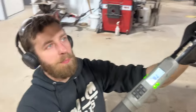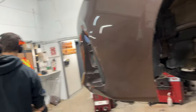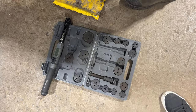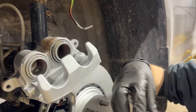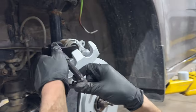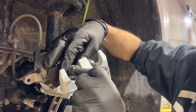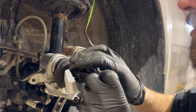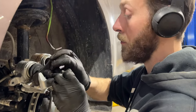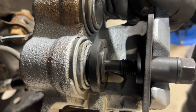The bracket is torqued up at 77 foot-pounds and the pads are in. The next step is to push the caliper pistons back. There is a tool for that — this kit by Matco comes with a bunch of different adapters, and none of them fit this Toyota, which is great. But it'll work anyway. We move the adjuster back so the plate is up against the housing, then just push them back in. You could use channel locks or a C-clamp, or if you have really nice calipers like on my Lexus, you just push them back by hand.